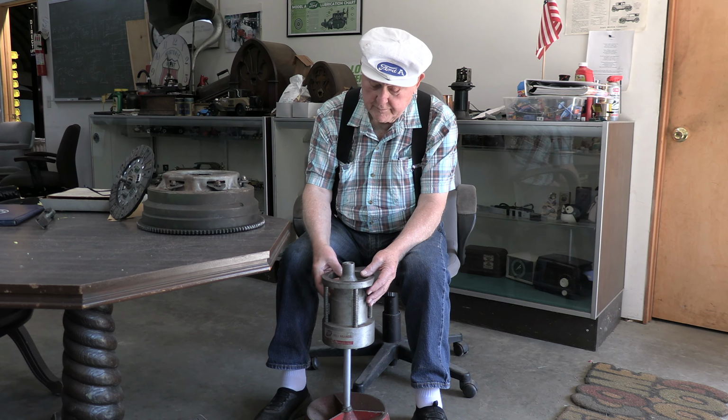But that's not the whole story, because we're going to put this pressure plate on, and the pressure plate may or may not be balanced. I've been told by the suppliers that it is balanced and adjusted. However, I guess I don't really believe them because I've purchased them and then measured them, and they're not necessarily adjusted or balanced.